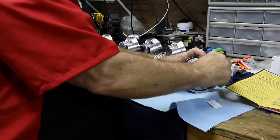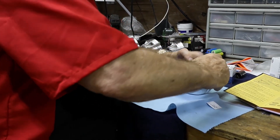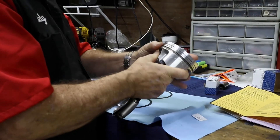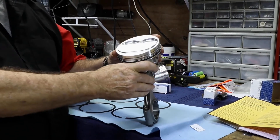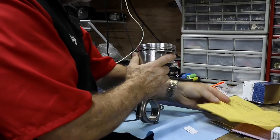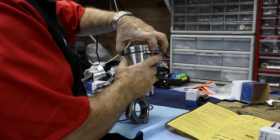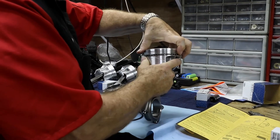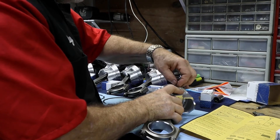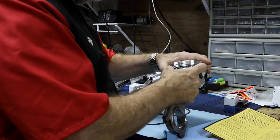The oil ring gets sandwiched in between two more solid rings, and essentially the oil ring acts as a kind of scraper from the splash back up and down the piston bore itself. Something different on the alignment here compared to the 349 build — you saw us put the compression rings on the same side with a slight angle from each other. This one is recommending that you split them up 180 degrees apart from each other for the actual ring gaps. The oil gap goes on approximately about the same side as your top compression ring, with a little bit of wiggle room there.